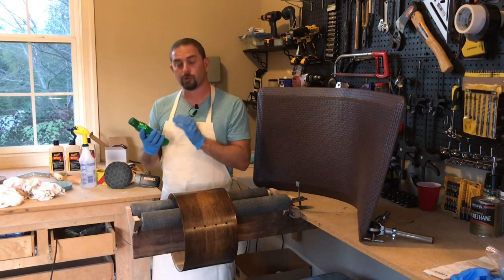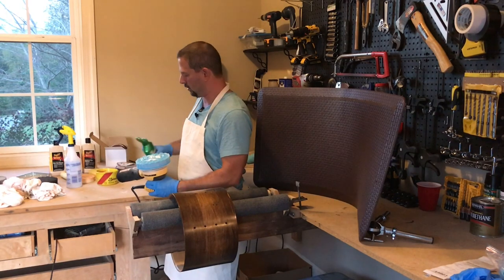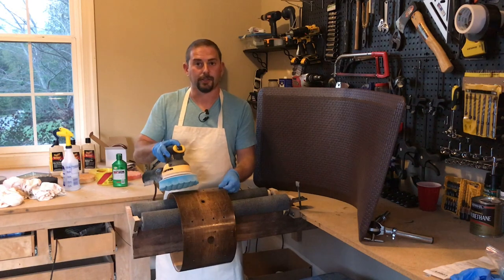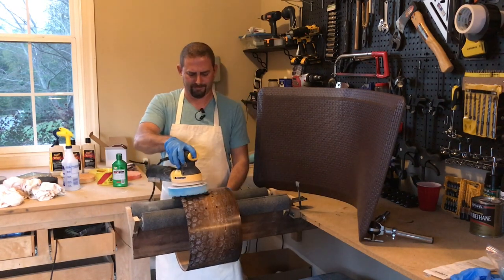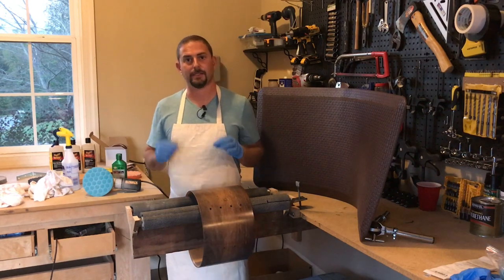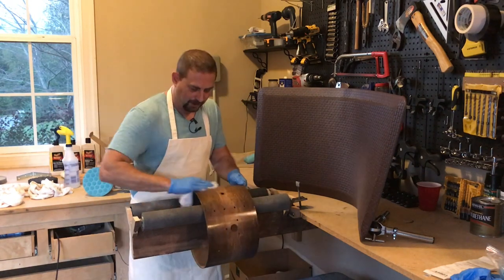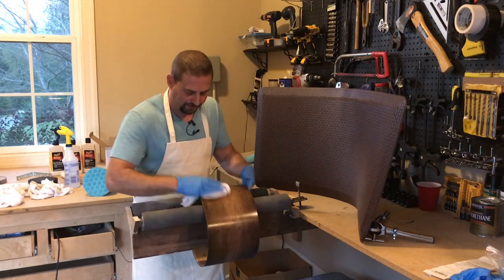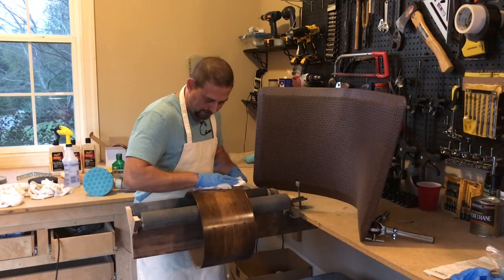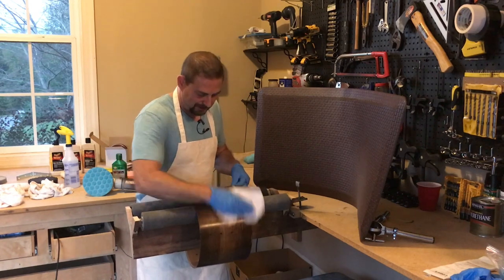Next step — we have our scratch and swirl remover, the ultra-fine cutting compound. Easy to remember: I've got four fingers and four different compounds, so use a different finger for each compound. Add your dabs and let's swirl it up. This is the last time — give it a couple of minutes and then we'll wipe this off. Here's my ultra-fine rag. It's a little tacky to the touch, so it turns into a little bit of a slurry — easier to wipe off. And looking at this, all those little dust nibs and imperfections are just gone. Any little pieces of hair, anything that's settled into the finish? Gone. It's smooth as glass.